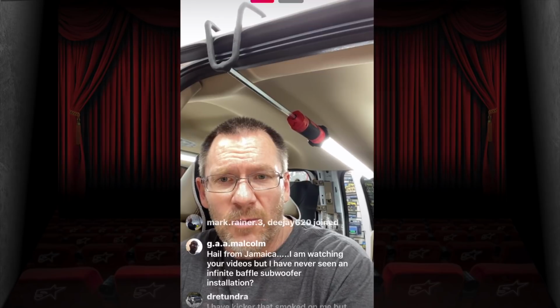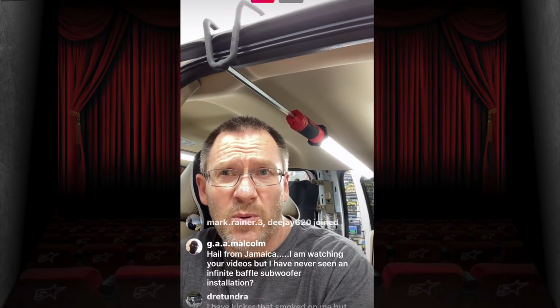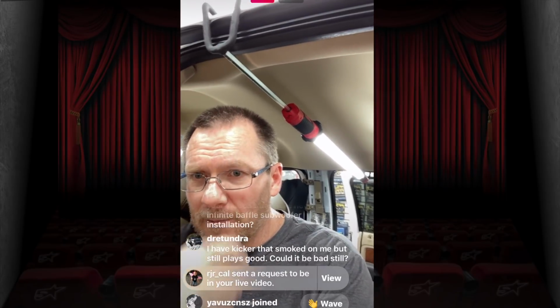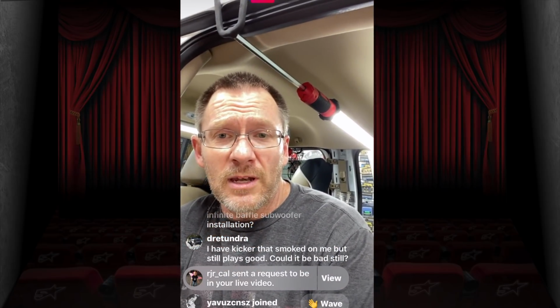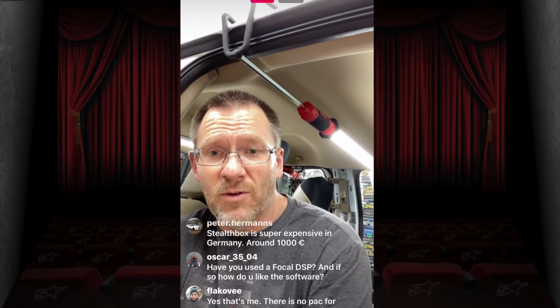Hail from Jamaica. I'm watching your videos, but I've never seen an infinite baffle subwoofer installation. I haven't done one in a really long time, other than just putting something in the rear deck. Yeah, that's a tough one. We did one years and years ago, when Nathan from PAC and I worked together, he did 4 Orion XTRs, what were called IBs or infinite baffles. And the secret to the infinite baffle is just making sure that the front of the woofer and the rear of the woofer never see each other. You have to make sure that they never do that.